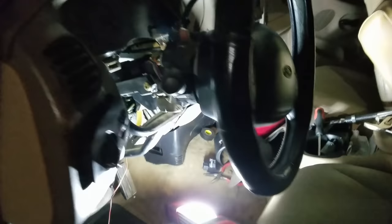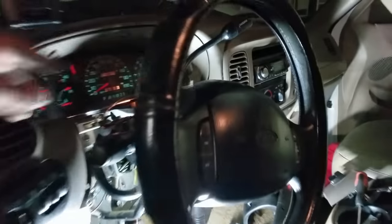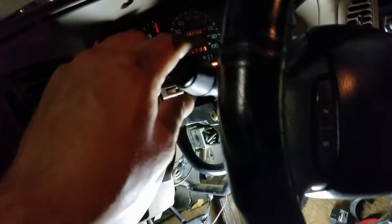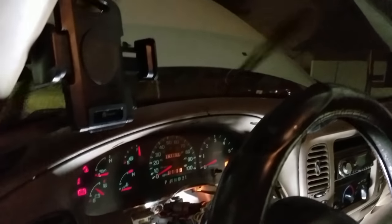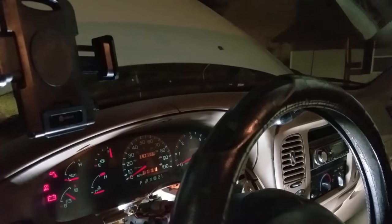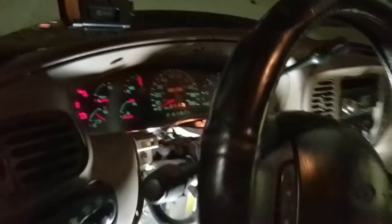It's plugged in and mounted — tuck your wires down in there. The rest of it's a piece of cake. You've got your switch changed out. Just to be sure, come under the hood and reconnect your battery before you go putting everything back together — make sure that your airbag doesn't blow up. The flashers are working — good sign. Turn signals work. Windshield wipers work. Intermittent works — I hear the motor. The brights work. The multi-function switch works.